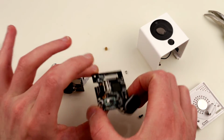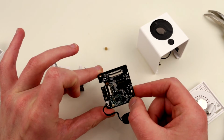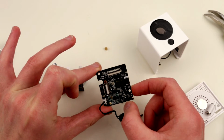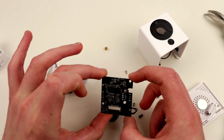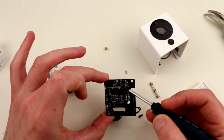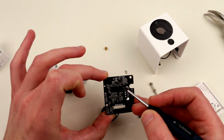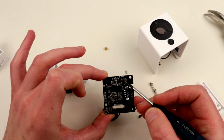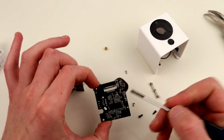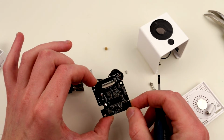So as I mentioned before, the processing unit consists of the processor. This is probably a serial ROM, highly likely. A voltage regulator of some sort. I'm going to take a closer look. And on the other side, we have another unit. Potentially, it's really hard to tell. It's actually quite power related, probably because it has 3 inductors around it, so we have to take a closer look. What is that? We have some unpopulated header over here. Doesn't say much, but there is something, potentially RX, TX and ground.